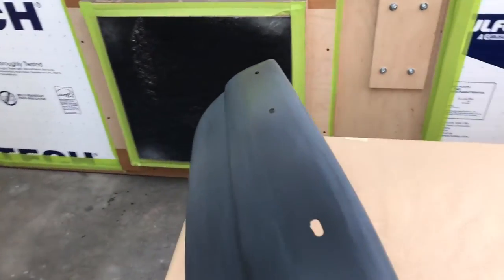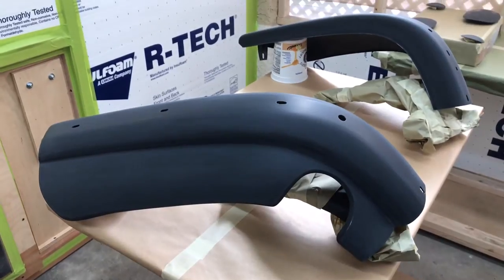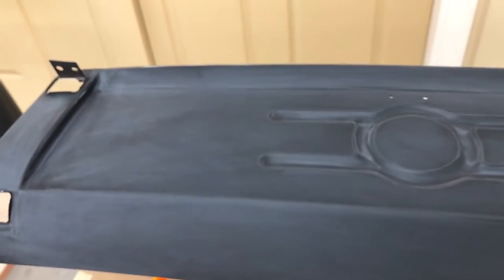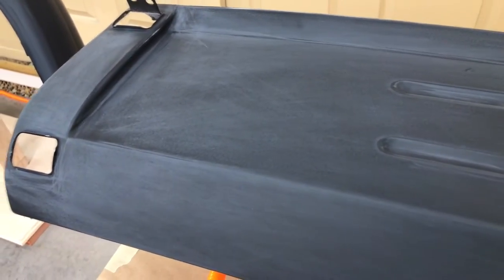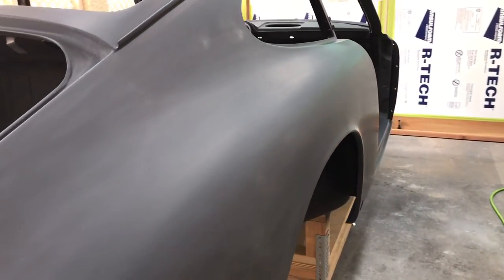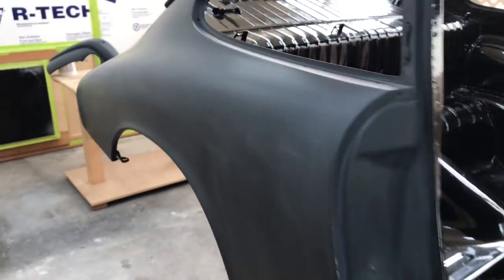What I do is scuff all this 100% to make sure it has a mechanical bite when the paint sticks to it. Then I like to follow it up with some wet 600. However, because this is your sealer coat, you've got to tread lightly - go real light. You can see a little bit of orange peel here, and it won't have any effect on polishing out your paint in the end and getting a smooth mirror finish. On the shell, I've re-blocked only the flat areas. If you can stand a little bit more sanding, block it one more time with a real light touch - almost like a jeweler's touch, kind of like polishing a gold watch. There are big rewards at the end of the paint for doing this right.